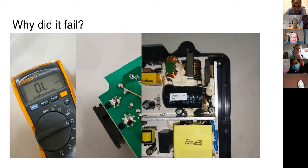Usually when a fuse blows, it's the rectifier bridge and the switching tube that blow — if those two get shorted, the fuse will blow. So maybe the correct move would have been to ask the hardware group first before putting in my own temporary fuse. That answered my curiosity about why the PSU failed. But there's another more exciting thing.